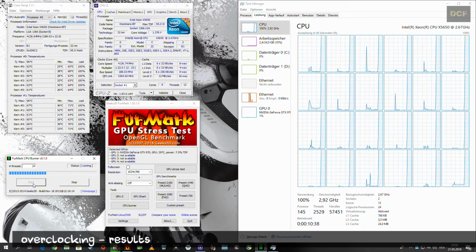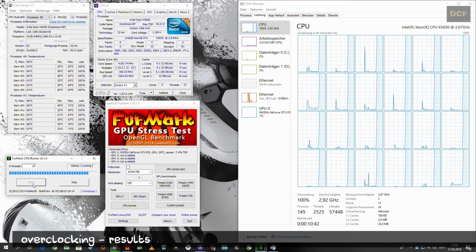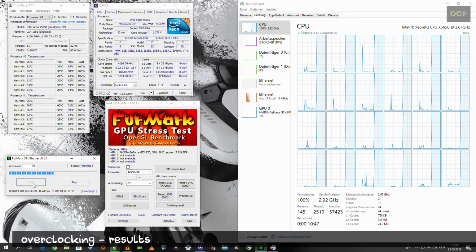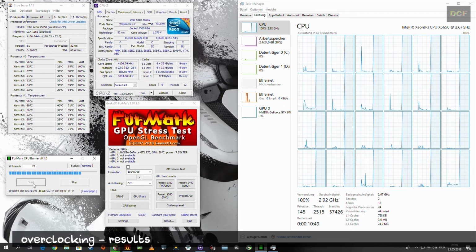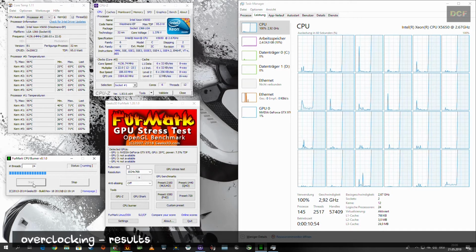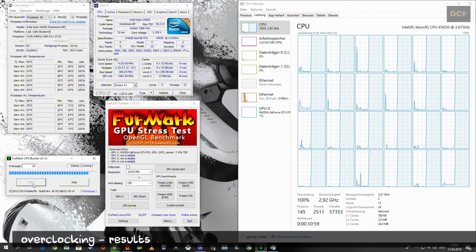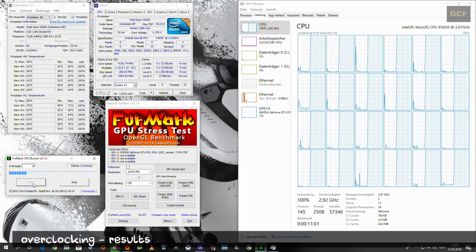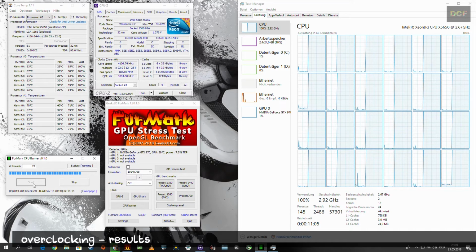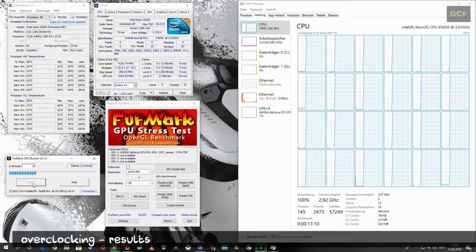So the overclock speed is 4.13 GHz on all cores with a multiplier of 22 and a base clock of 188 MHz. Let's accept this. The system is up and running and it's benchmark time. The benchmarks were performed with four different configurations: stock speed with one and two CPUs, and overclocked with one and two CPUs. Two graphic settings were used, one in 720p with lowest settings and one in 1440p with max settings. So it should be possible to distinguish the CPU and GPU bottlenecks. Enjoy!